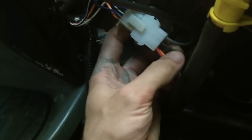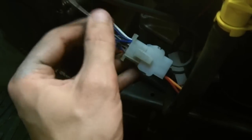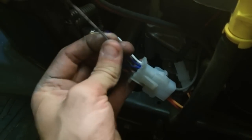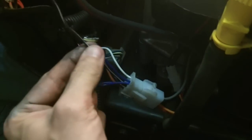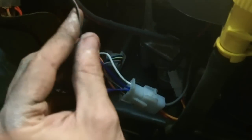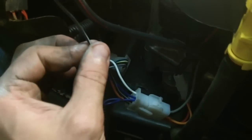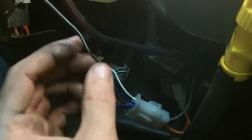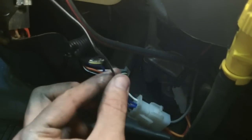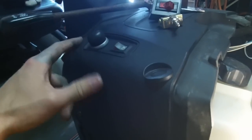As we can see, the black kill wire lines up on this side, except when it comes out of here it's no longer black — it's actually black with a white line. You're going to take this, and one of these actually goes to the clutch and brake safety switch. If you follow that all the way across, you can cut it off and have enough lead to go from here up through to a switch on the dash, which is right here on mine.